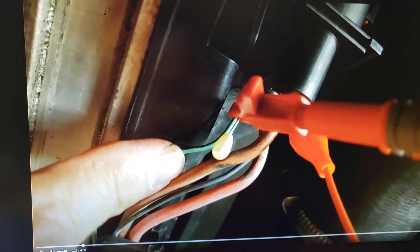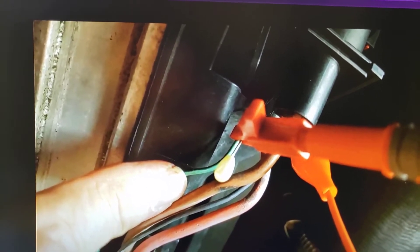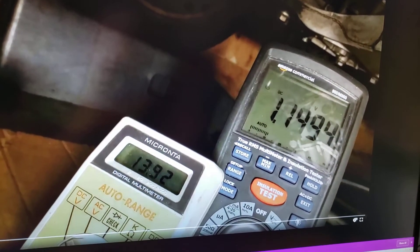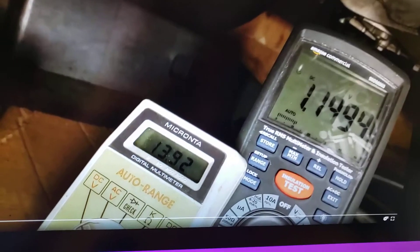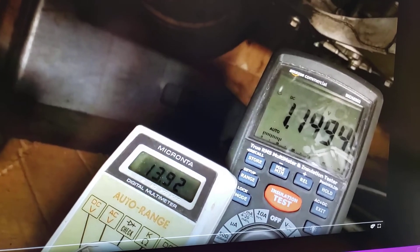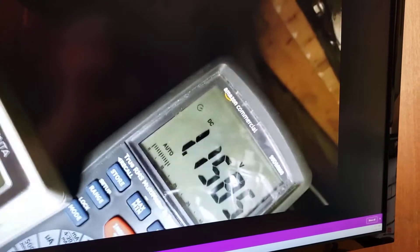I let the car warm up in idle mode for at least 10 minutes and it came up to operating temperature. One thing I found was — here are the two multimeters showing the values when the car was running and warm — the multimeter on the right is showing the voltage of the little green wire, and basically it fluctuates a lot. Its voltage is somewhere around 1.15 to 1.16 volts when the engine is warm but not super warm.